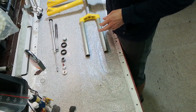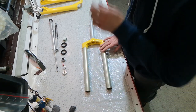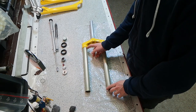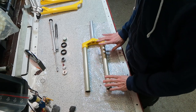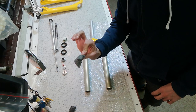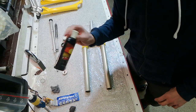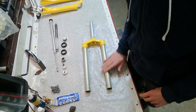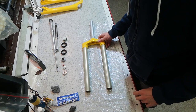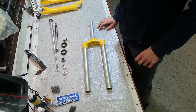What I'm going to do now: first I'll put away the lower legs and service the upper ones. I need to clean the paint from below the crown, then I'm going to use steel wool, polishing paste, and wax to smooth the stanchions on the outside and hopefully clean the inside as well. See you in about 20 minutes.